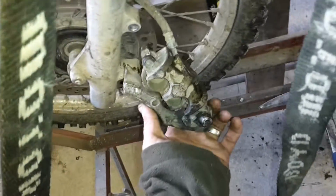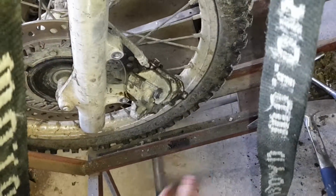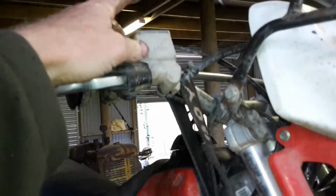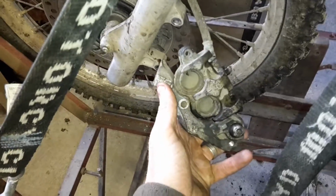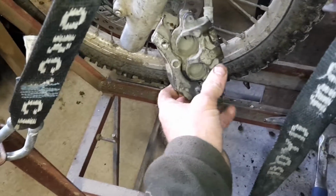Well, you live and you learn. I should have pushed those out before I undid it the first time, because now, obviously, there's air in it and there's nothing there, so I'm going to have to take the top off, put some oil in there, and hope that I can get it out. So that's alright, that's not a biggie. But in my job being a farmer, I'm always learning things, usually by not making major mistakes, but making little mistakes.